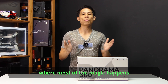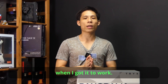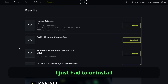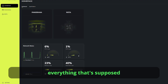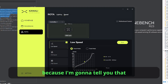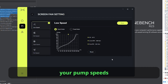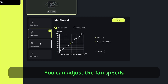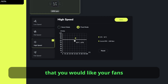Let's go on to Kanali, where most of the magic happens. It was a relief when I got it to work. The accompanying software really makes or breaks an AIO — and at least Kanali isn't that bad. I just had to uninstall and reinstall once and update the firmware because uploaded videos weren't showing thumbnails. After that, everything that's supposed to be detected is detected. You can see all the fan speeds in Kanali — just look for the correct menu to find fan speeds, pump speeds, and even the mini fan inside the water block. Make sure the LCD screen enclosure is on the water block so it can read the pump speed. You can adjust fan speeds with either smart fan mode or fixed mode, with four fan curves available in smart mode.